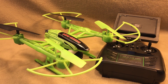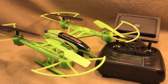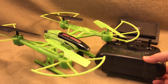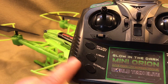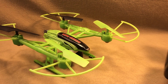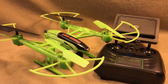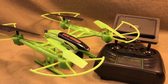First, we're going to talk about battery life — there is nothing that makes a drone more fun than being in the air, and to be in the air you need batteries. If you're going to use the factory 650 milliamp battery, as soon as you turn the drone on and get it ready, hit the light button to turn off the pod lights to save a little juice. Also make sure you don't use photo or video if you're just wanting to fly around. Make sure you take the SD card out, because the SD card has to mount every time the drone is powered up, and that takes juice. Taking the SD card out will get you those extra little bits of flight time.